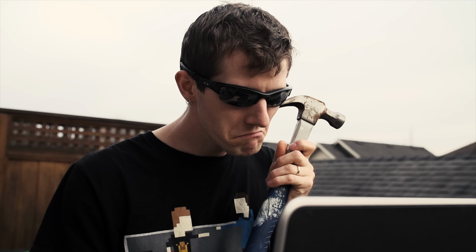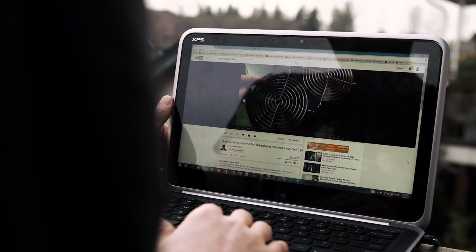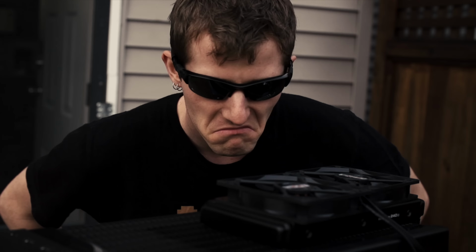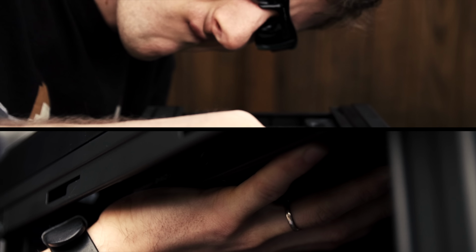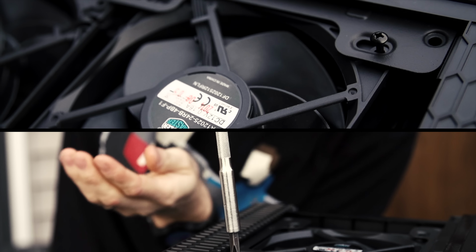Thankfully, I found this great video on the subject. This guy is anything but rugged, but he suggested having my fans pull air through the radiator and out of the case for a good balance of overall system cooling and ease of cleaning. Something I can certainly appreciate. I ran the long screws through the top of the case and the 4 corners of the fans like a spit through a pig. Then, after some fiddling about, got the first one threaded, and from there, it got much easier to mount the radiator.